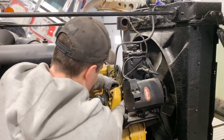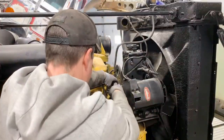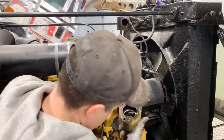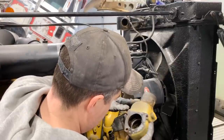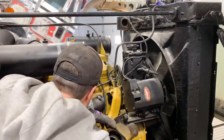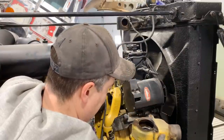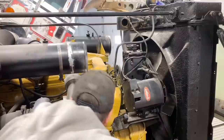So what I'm trying to get at here is the thermostat. And what's interesting to me is there's nothing in here — that's very curious. Did the previous owner take the thermostat out? Which might explain why this motor never seemed to ever get up to temperature. Well, let's see what those new parts look like from CAT.